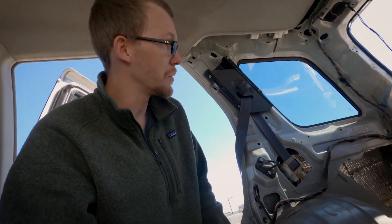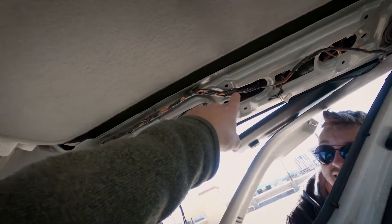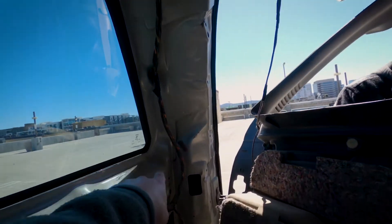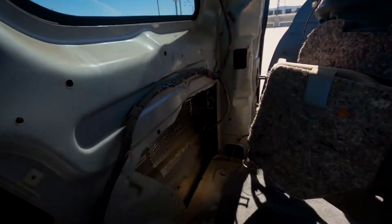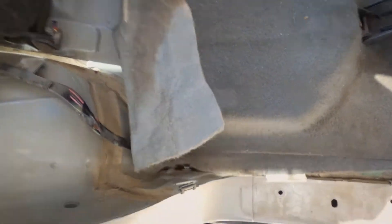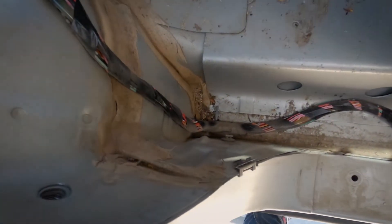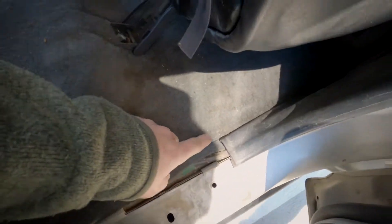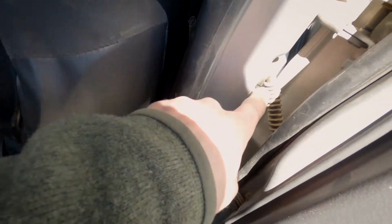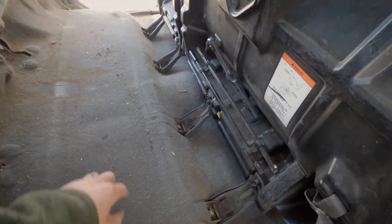We took off a couple more components than we needed to, but this is gonna be okay because it actually looks like the wires route up and over down here and through. I actually thought it went through the body cavity, but they're on the outside, which is nice. And it runs down the passenger side, down here, and under the carpet. So we're gonna find the right channel and left channel and send the right channel up through the B pillar here, through the corrugated line here and into the speakers. And then we're gonna send the left channel off under the carpet this way.